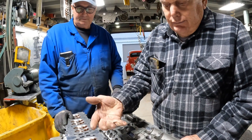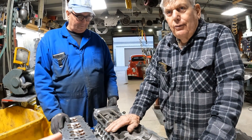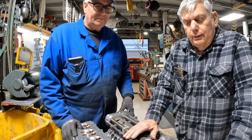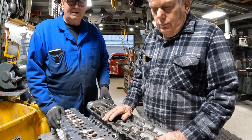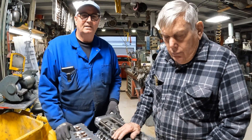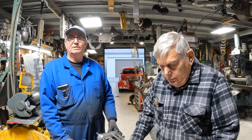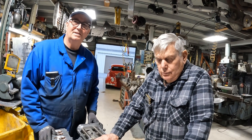Does that create more back pressure with a smaller seat? A little bit, yeah. It's more to get rid of the over-scavenging — that's where some of your intake charge just blows out the exhaust valve. You're making use of the inertia of the air, and you want to make sure it goes into the cylinder, not out the exhaust valve.